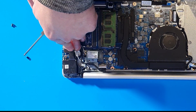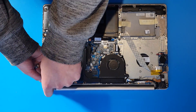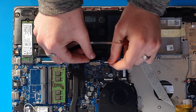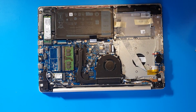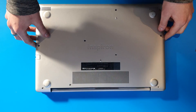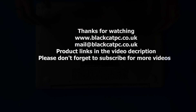When you lower the hinge, make sure you don't crush the cables. All right — now we've got to remember to plug the battery back in. Not going to lie, I've forgotten that a few times — we've all done it. All back together. We also sell the CMOS battery — I think I'm going to get them back on the website soon. I can get hold of other parts for this laptop and similar models. All I've got to do now is put the screws back in.